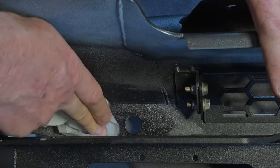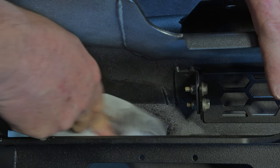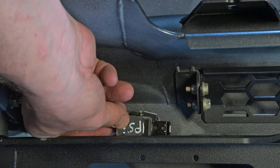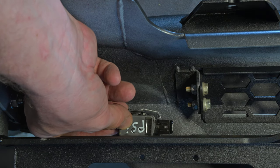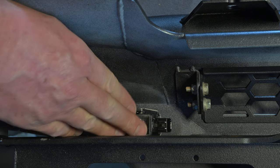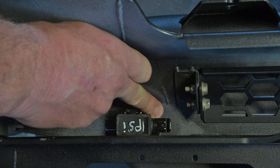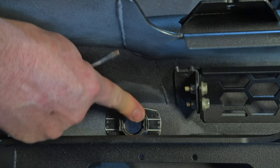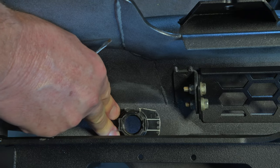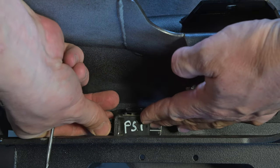Now put the bar face down onto the table and refit the sensors and headlight washers. First clean around the sensor holes with wax and grease remover. Then after applying 3M VHB double-sided tape to the brackets and refitting the sensors into the brackets, centre each parking sensor into each hole and attach them to the bar. Once each sensor assembly is in position, remove the sensor from the bracket and push firmly on the mount to ensure good adhesion before clipping the sensor back into place.